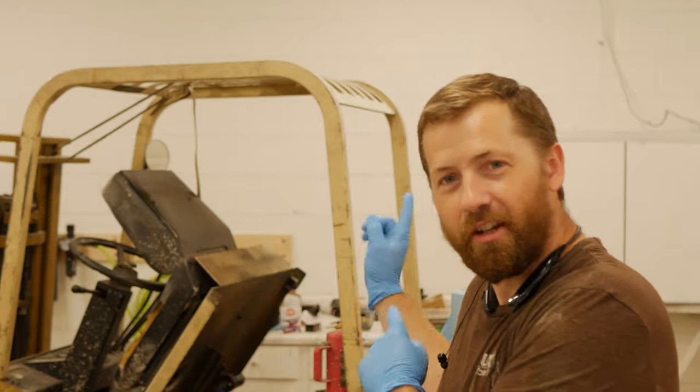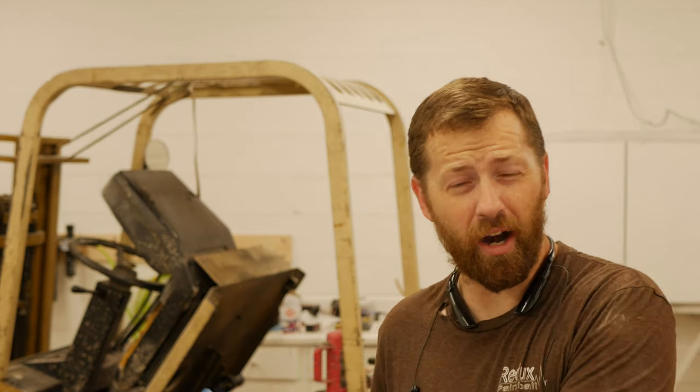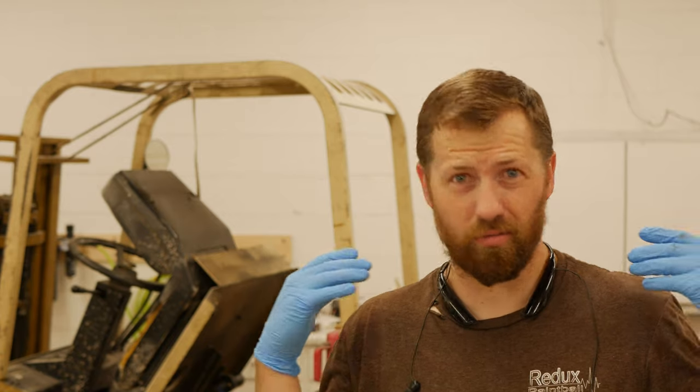But I was out here cleaning up shop, and I got distracted, squirrel, and decided to work on the forklift again and figure out our no spark condition. With all new ignition components, except for the cap and rotor, there still should be a spark on the contact points that we replaced, and I wasn't getting that. So I decided to trace all the wiring and check everything out, make sure it wasn't an internal wiring issue and not a component issue, so we're not just throwing components at it for no good reason. I did test all the components before, as previously stated.